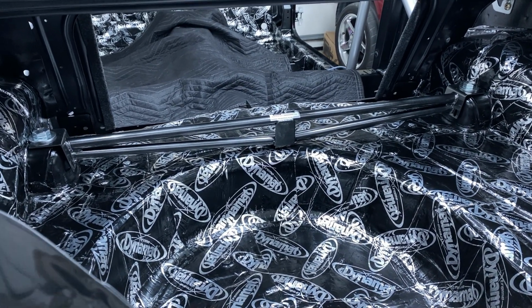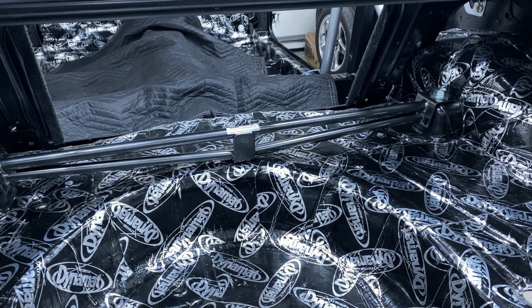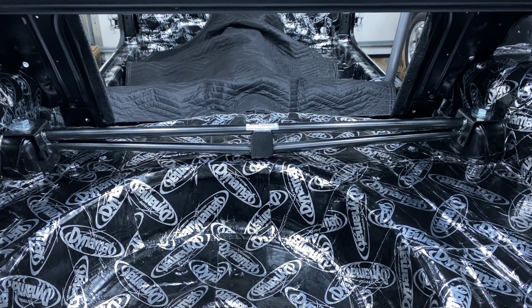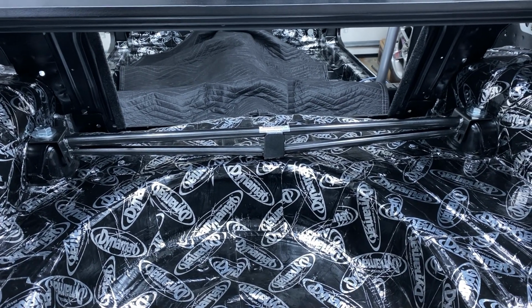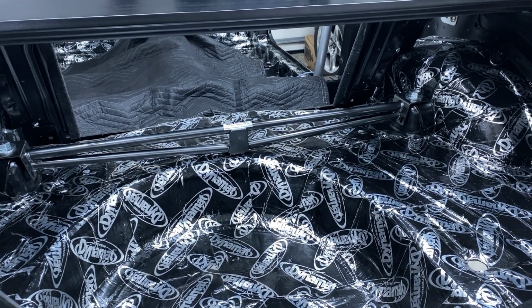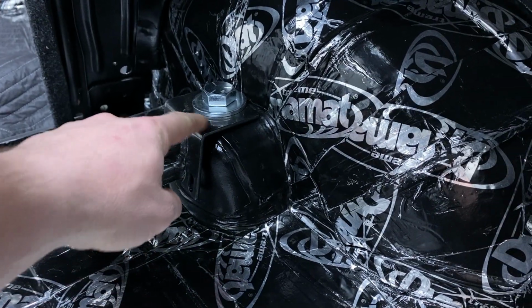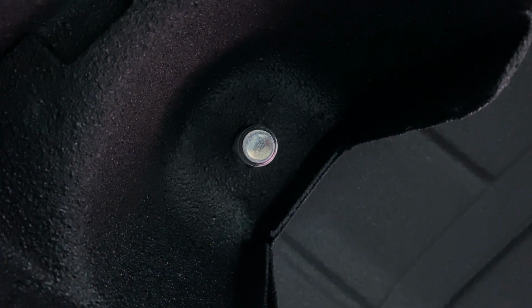The other thing I did say was the brace holes didn't line up at the top with the shock tower holes, and that's technically true, but luckily it's not as bad as I thought. The brace hole's diameter is larger, and they're actually offset out a little wider than the shock tower holes. And because they're larger in diameter, they still line up with the inner edge of the shock tower hole, so it's not a problem. Hopefully that makes sense. I have a 3/4 inch bolt in here that fits through no problem with a bit of slack still. So no modification needed in that department.